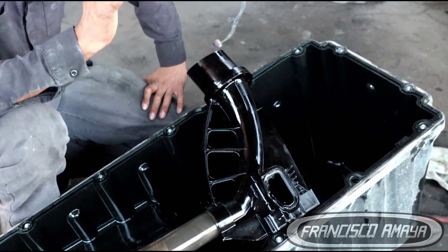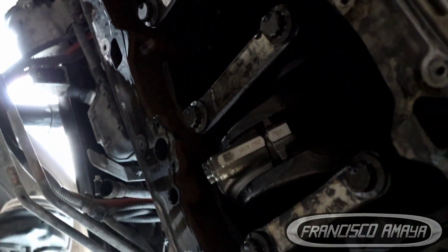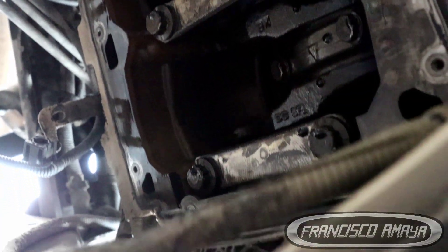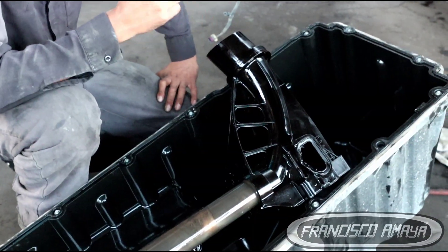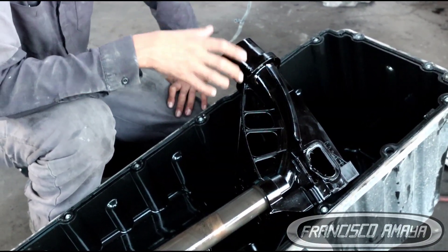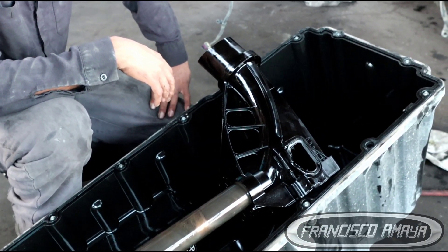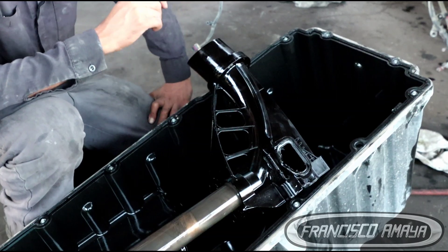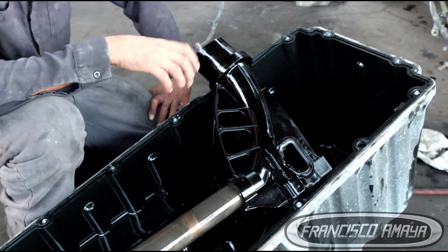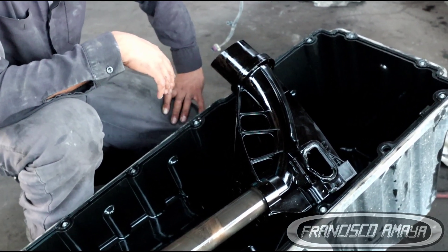This caused very intense damage — the entire crankshaft has to be replaced. If you look at the crankshaft right now, everything looks together, but the damage will be visible once you take it apart. You'll want to see how many rod or main bearings were damaged. This is a very severe problem. If your oil pressure drops, don't try to start your engine again. Just let the engine sit, take it to a shop, and tell them the oil pressure dropped completely.